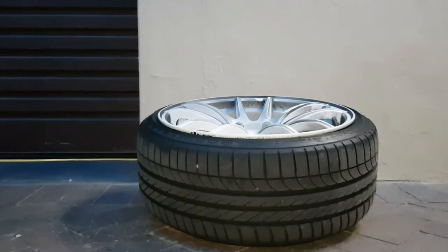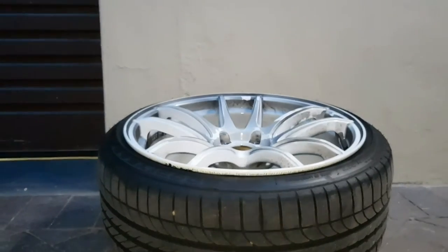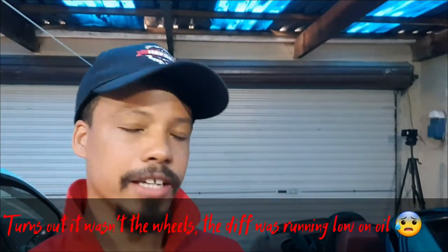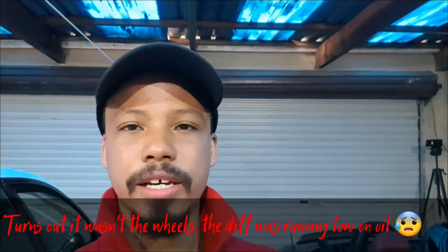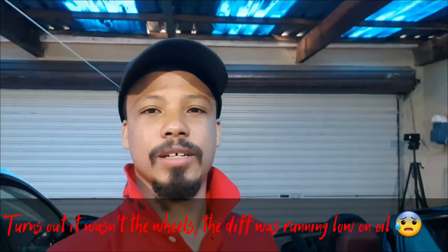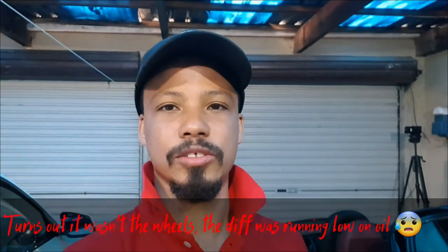He also mentioned that he's actually having a bit of trouble with these wheels, in a sense that there's some sort of wobble that is happening on the car as you're driving, and I actually felt it on the front quite aggressively as I was bringing the car home. So I'm going to take a look at the suspension bushes as well, just to make sure that everything's in order there. But I also suspect that there could be flat spot on these tires, or that the rims could in actual fact be buckled.